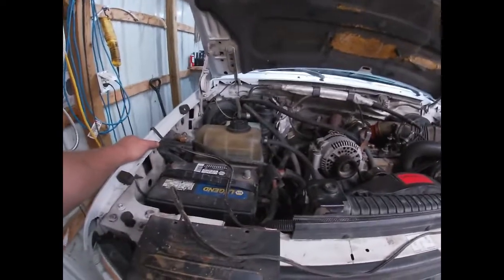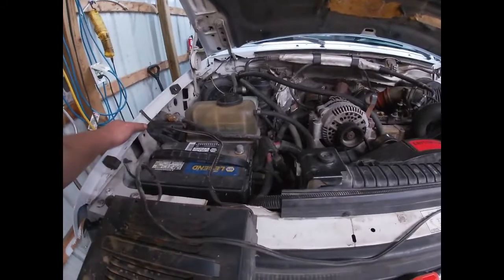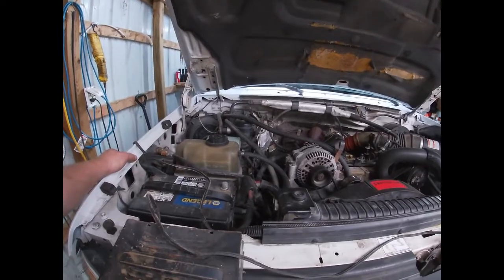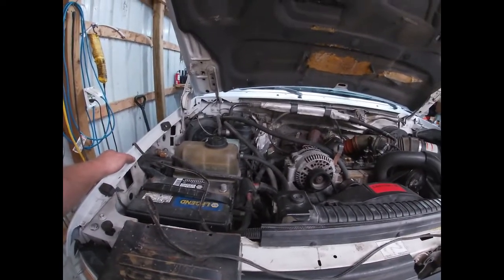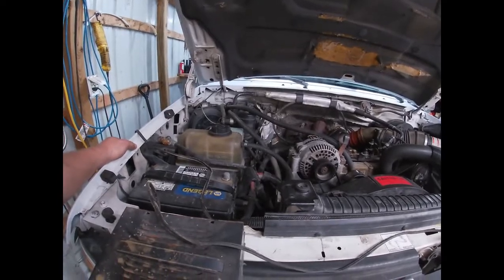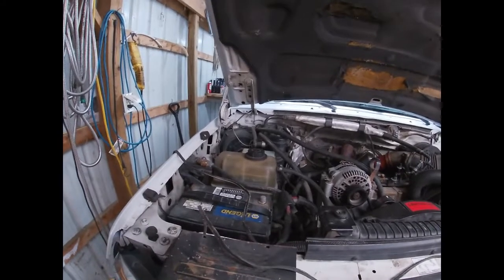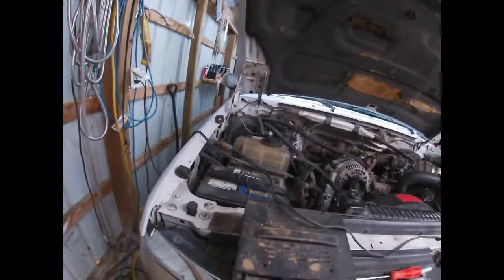So, yeah. So anyway, we're going to say that that battery is good and clean the terminals and put it back on there, I guess. Still don't like the fact that it's drawing, which I guess we could test that too real quick, do a milliamps draw test on it, see what it does. But anyway, we may just wait and hold off on this and save it for another video, because that's doing way better than I thought it was. So maybe perhaps I have a bad cable or something like that. But as I said, maybe we'll just save it for another video.